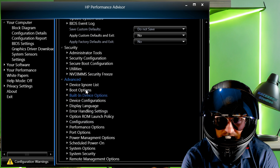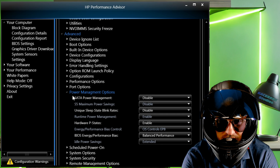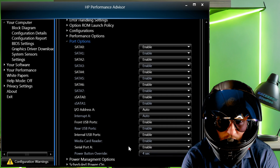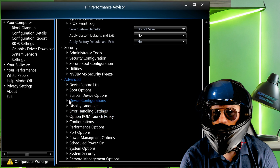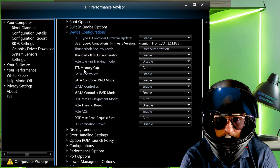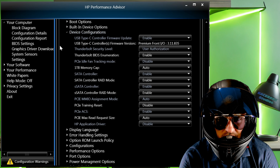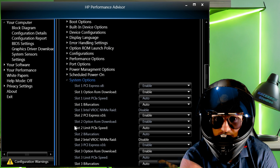We'll try different settings looking for PCIe slots. Port options? No, that's SATA and USB ports. Performance? No — though you do want to make sure you're in performance mode. Device configuration? Not there either. There's Thunderbolt and USB-C, which is handy — make sure you've got Thunderbolt functionality if you're still using it. But still not PCIe. Then — System Options. That was my fourth guess, so not doing too badly.